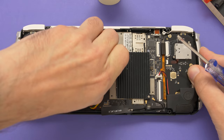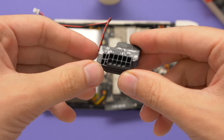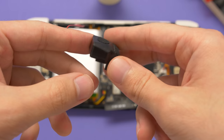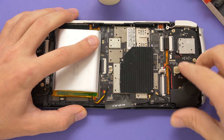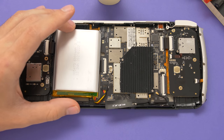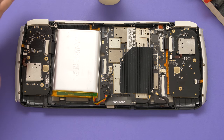We're going to continue with the teardown. First, we're going to disconnect the speaker cable and remove the speaker. There's a pretty substantial speaker chamber on Odin, which is part of the reason why it has really good bass frequencies. This is attached with adhesive to the controller board and can come off by applying some force. We're going to do the exact same thing to the other speaker. The next thing we're going to do is unplug the battery — admittedly, you should unplug this first before doing anything, but I like living on the edge.